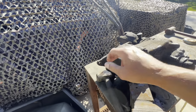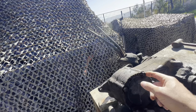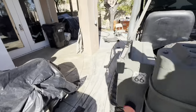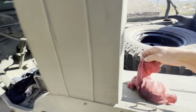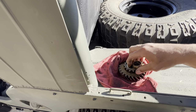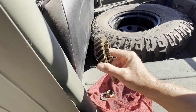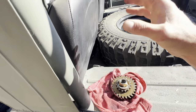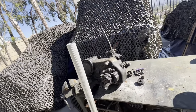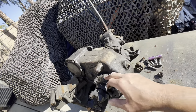In order for this to come out, you gotta take off all of these bolts - there's five of them. Take those bolts out, it'll be loose. Then you gotta come back here, take off this, and inside there's cluster gears. I'll put them over here for safe keeping. There's your cluster gear with the nut - I think this is a 32 or something like that. Anyhow this comes off, goes in, comes off. And once this is out, the whole transfer case will pop on out and you just pull it right off of there. This is where your speedometer hooks up. I wouldn't doubt if that's where all this oil is coming from, but nevertheless it's out.